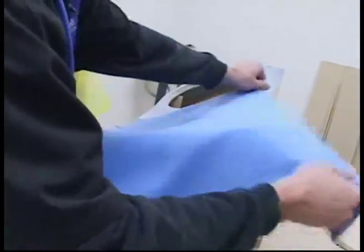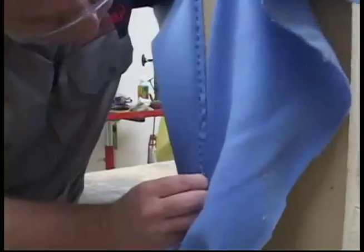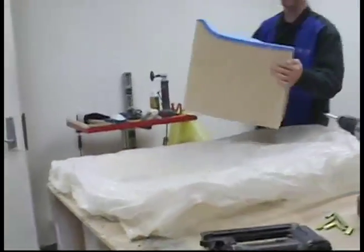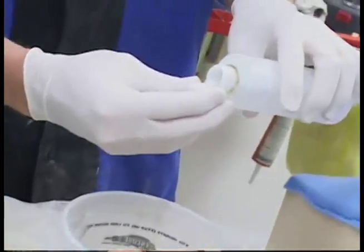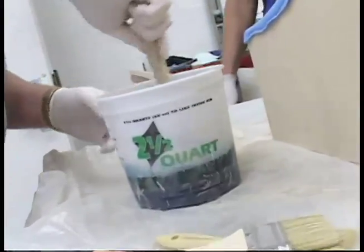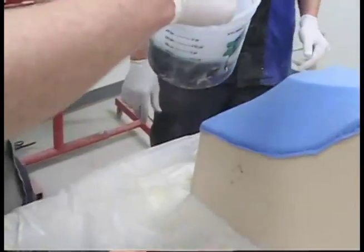Headliner cloth is Dave's material of choice for his subwoofer cases. It stretches easy and it's strong when pulled tight. That's an important quality when you're pulling over hard wooden edges. Resin, that's the fun one. If you mix it too hot, it will tend to get hot and it will burn, it will crack, it will smoke, it will do all kinds of things you don't want it to do. So you've got to be careful with the resin, especially on different temperature days.